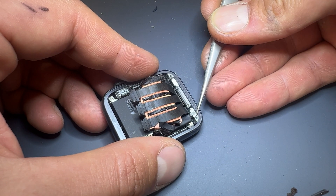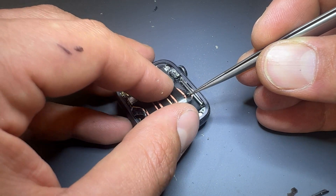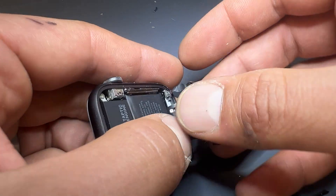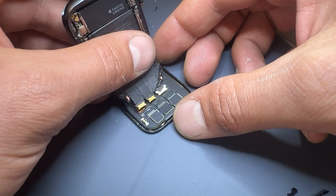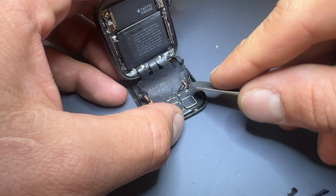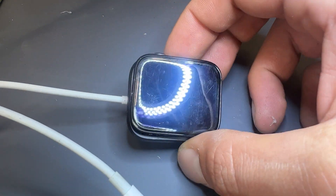This chassis has got one of them still stuck on it — we'll get that out of the way and then untangle the tape. One of them has broken off; it's not going to affect use of the device but it is better to install it than ignore it. Before sticking it down, I want to test that it works, so we'll grab our screen and reconnect the three ZIF connectors for the OLED, the touch, and the NFC. Secure them into place and now when we put this onto charge we should see an image on there.